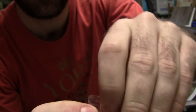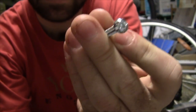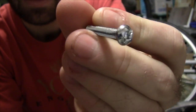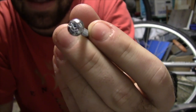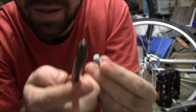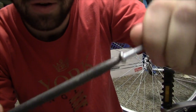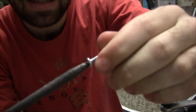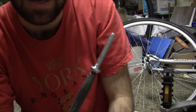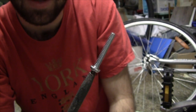It's not. They don't have it in the United States. So you can see there the end of it has a square. It also has a slotted screwdriver end as well. But there's an end that takes a square thing that looks like this, and it fits right in the end there. And those have a very good grip. It's just as good as an Allen key has. It stays in there, and you're able to tighten it on without the screwdriver slipping at all.